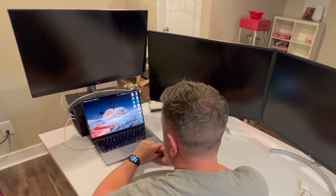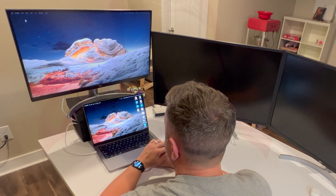As an example, you could have your MacBook Air or your 13-inch MacBook Pro connected to one external display. And even if you go out and buy a dock and hook up your M1 MacBook Air to that dock — it may have two different inputs for a display — you're only going to be able to natively support one external display from that M1 chip.